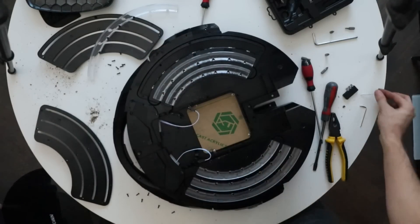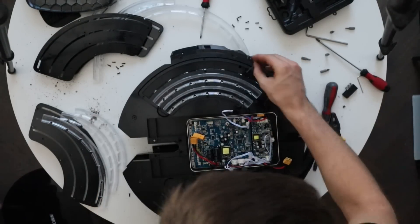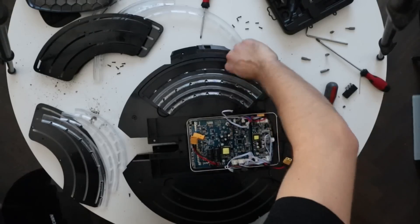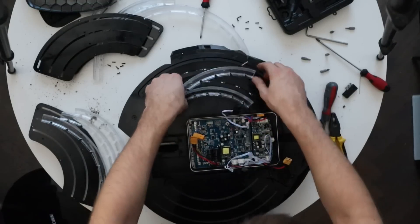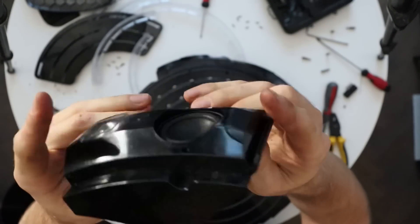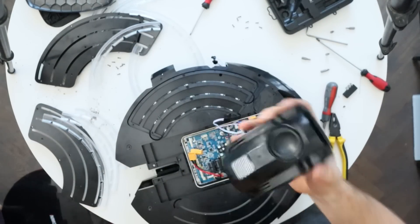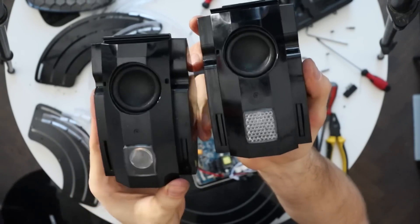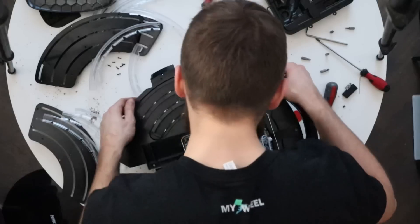The key screw you need to access is located in the largest of the three LED panels. The screws holding both halves together are not placed symmetrically — for example, the front element's screw goes through from left to right and can be unscrewed from the left, while some rear screws can only be unscrewed from the right panel. The front and rear each have a combined speaker and light module: the front has a bright white light and the rear has a red light, each with just two connectors. It's a pretty cool modular design on the V10F.